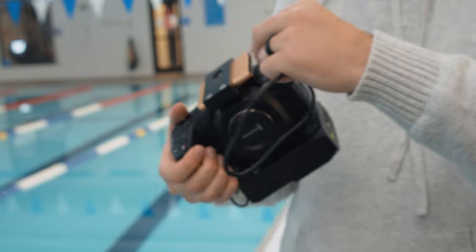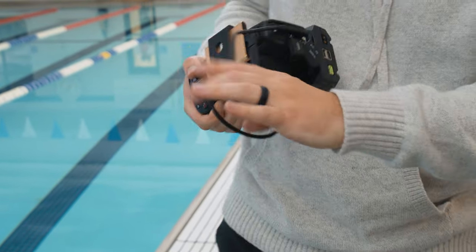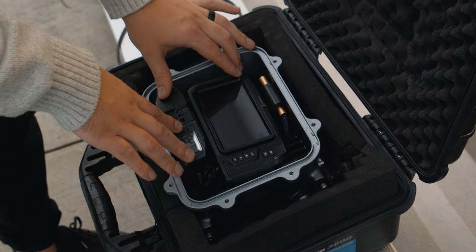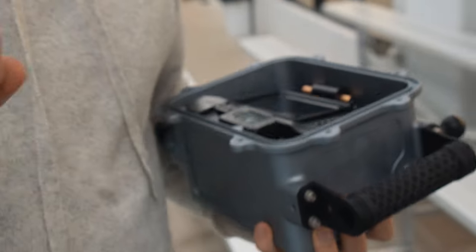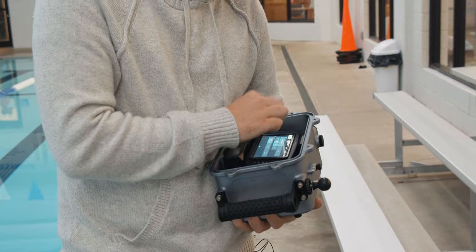So when you put these in, you're going to want to put the cable facing towards where the lens would go. It helps later not to have that in front — then just connect that up, and that's all you need to do to get it into this housing. The next step: slowly insert this into the housing, and you don't want to force it too hard because they have foam blocks that help guide it in, and if it goes in correctly, you'll know — it'll go all the way in. There's no need to adjust it or anything, and as you can see inside, all the buttons work. One thing you want to do before you close all this up is just double check your settings one more time. I like to film in constant quality when I'm doing underwater footage, just so I don't have to worry about the bit rate because there's a lot of stuff going on underwater. So you'll just want to go ahead and set all that up before you get in the water.